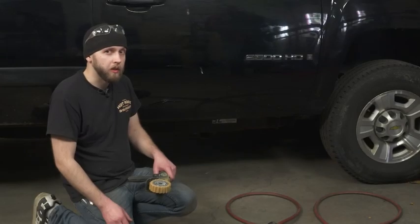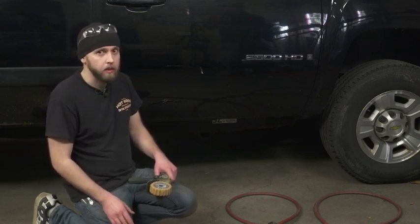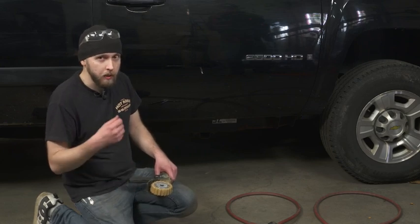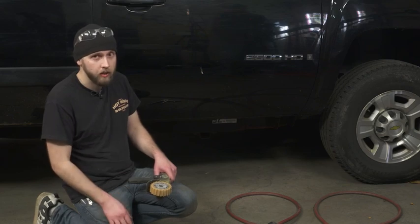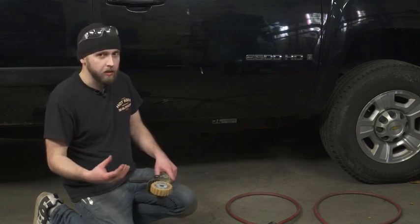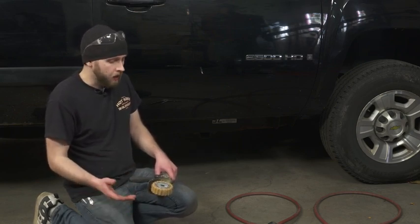The process of using an eraser wheel is pretty easy, but there are a couple tips you need to know. First off, you never want to build heat, so don't focus on one little spot because it'll just tear the paint off. So constantly keep the wheel moving as you're removing decal or molding tape in this case. And don't dig in with pressure on it, because then you're building heat into the panel again. So, lightly going over the panel back and forth to remove it.